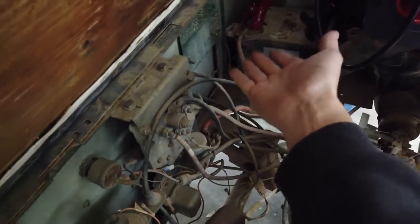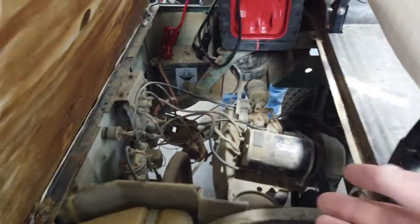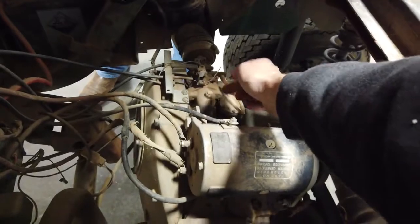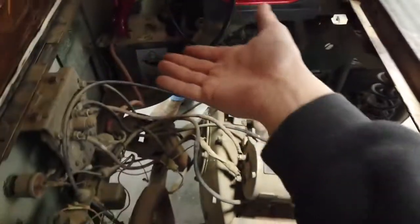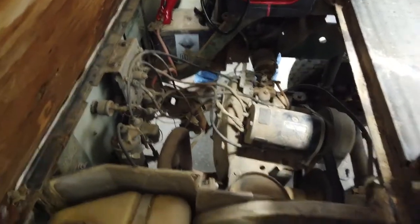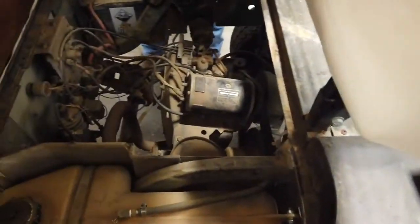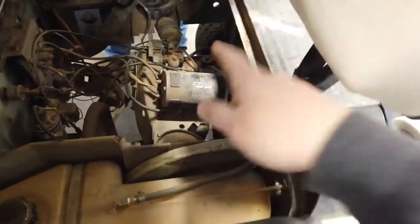Oil only comes from the oil tank. So the fuel tank mixes with the oil. There's no oil tank. So I was just looking up. It looks like people can delete it, because the oil would usually come over and then inject into here. That's been plugged and everything. So it must not have the oil injection, because a lot of people would delete that little deal and then just mix it 1 ounce to 1 gallon, I guess. Some were saying 1.5 once you do this delete or whatever.